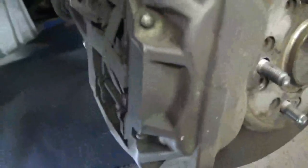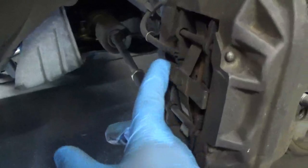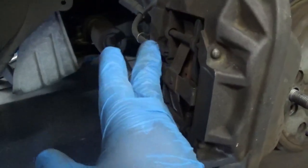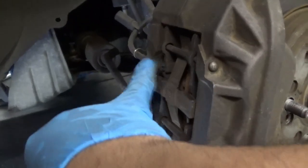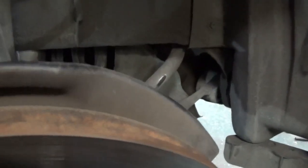On the passenger side the Lexus LS has this sensor. I think this sensor costs like 20 to 40 bucks. What this sensor does is when you wear out your brake pads it alerts the system that your brakes are low and you need to change them. Why spend 20 to 40 bucks extra on this sensor when you can just change your brakes before you get to that point? If you do happen to wait too long to change your brakes and need to change the sensor, it's attached to the back brake pad right here. You could just unplug it right there, but I don't need to replace it because mine is intact.